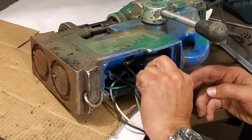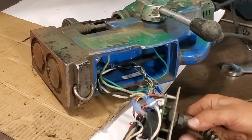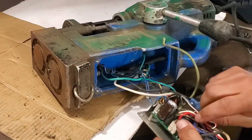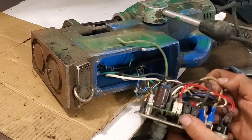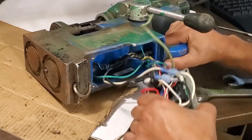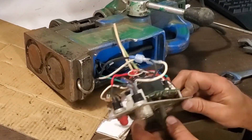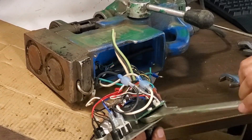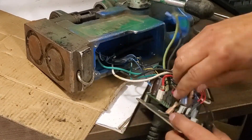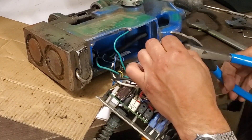To replace the main power cord, I start by removing the ground wire from the frame, then undo the strain relief from the front of the switch panel. Next I pull the white wire off from the power switch and separate the terminals, then do the same with the black wire. I cut the terminals off the old wires and pull them through the panel, strip back my new power cable and pass the wires through the panel and tighten the strain relief. I put terminals on the wires and connect them to the pairing terminals before connecting the pairs back to the power switch. Then with the ground terminals replaced and grounded to the case, the cord replacement is complete.